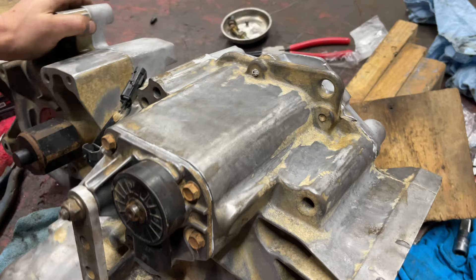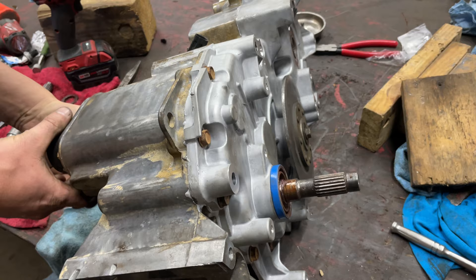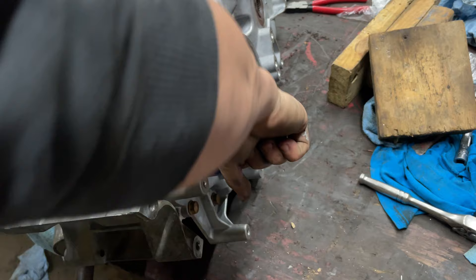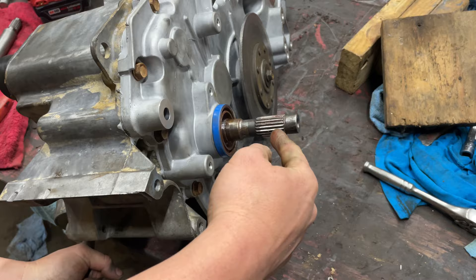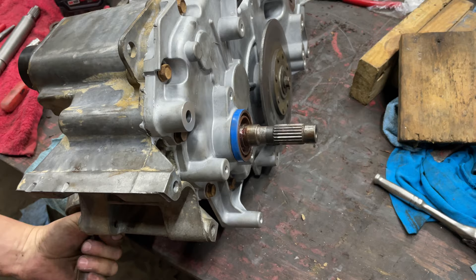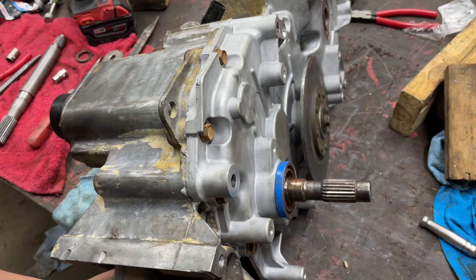Okay, we got that in. Now what's left to do is put sealer around this, clean these two facings off, and then put our cap on and put our bolts in. Now one of the last things we've got to do is put our shifting arm back on — this has got a notch in it to fit this shaft, and you'll notice it goes on pretty good one way. If you're trying to put it on the wrong way it won't go on. So we got it on there. Now we can turn our transmission up and it shifts through all the gears. That's neutral and we're turning this — our output shaft isn't turning. That should be low. That should be right here.